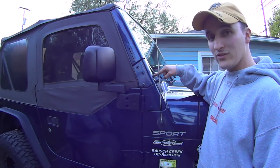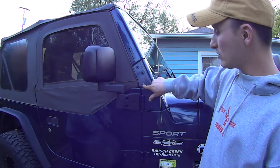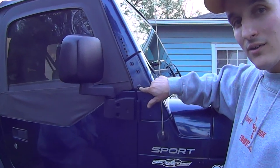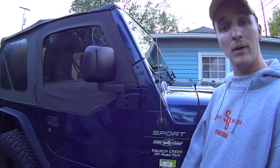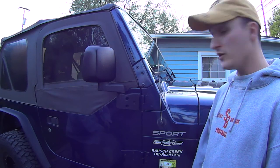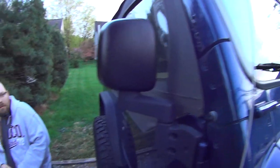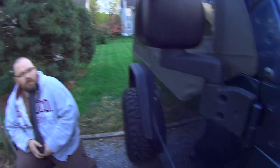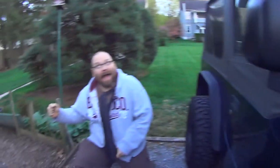I need to get this front Torx out. This is the Torx bolt that is the lock for folding the windshield down. But these other three are all painted on and are notorious for stripping. I'm really not feeling too good about this. I've got to get a T40 in there. Get the breaker bar — we're going to see if we can bust them loose. And if that doesn't work, I'm going to warm them up with the heat gun. And if that doesn't work, we're going to dance. Sam's going to dance and I'm going to cry.